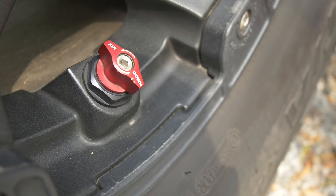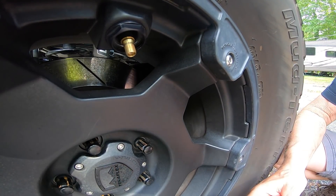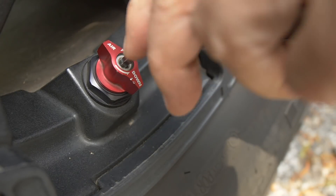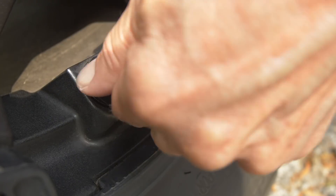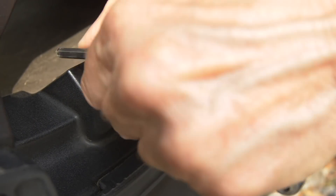Let's go through a quick preset adjustment how-to. Just remove the cap and throw a gauge on the fill stem. Grab a 3/16 Allen, put it in the center of the air release, then twist open the air down valve. By winding the deflator all the way out to the stop the process is much quicker, but a few turns works very nicely.